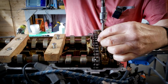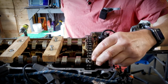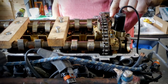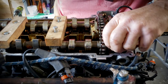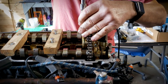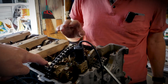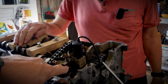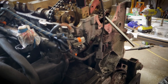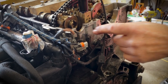The problem is the caps are marked in German. Intake starts with 'E' in German, so the intake bearing cap is marked with an E right here. Exhaust is marked with an A — 'Auslass' in German — so you have to remember it's German, not English. E is not for exhaust. Also to recap: on this bank, the intake cam notch faces away from the block; when doing bank two — cylinders four, five, six — you want that notch to be towards the block.